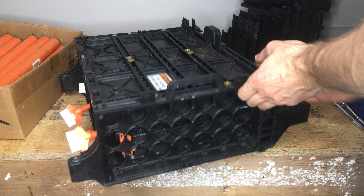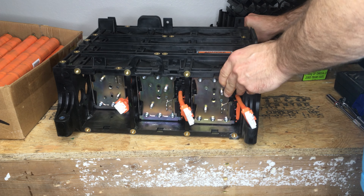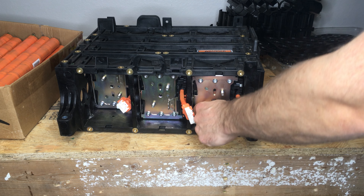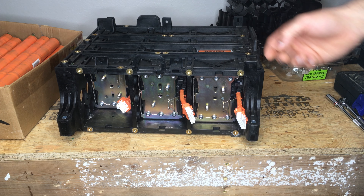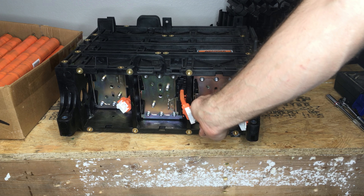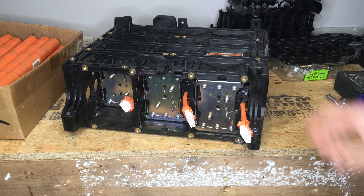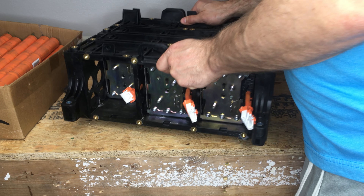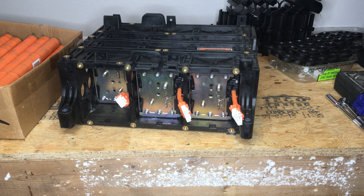The OEM computers still fit on top, and at that point all you need to do is drill some holes to secure the plate. I'm thinking just make a small 3D printed plate to prototype, and it'll screw onto these M8 studs on this side — do the same thing on the other side — and that's a complete battery solution. It's fairly light. That is a match made in heaven.